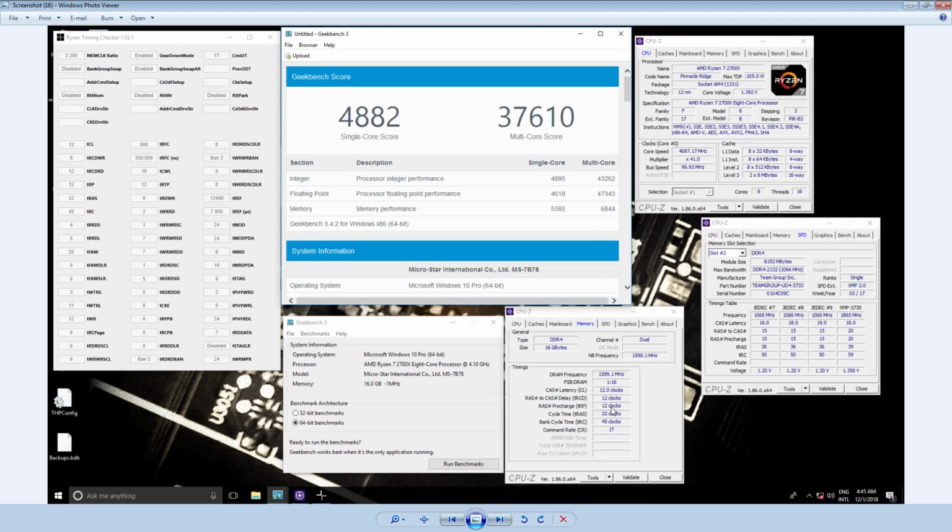And then if we go to low frequency testing, here we are at 3,200 megahertz, 12, 12, 12, 32, which is a really easy setting to run on B-die at 1.5 volts, on good B-die anyway. The Antec stuff doesn't have a chance at this. You could try all day at 1.8 volts and it's still not going to post this. But this spits out about 6,800 points.